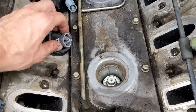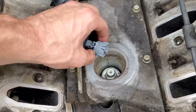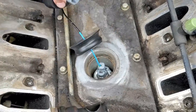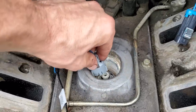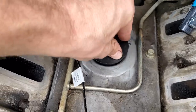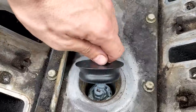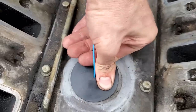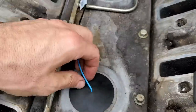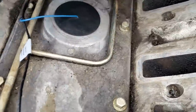All right, now that our new knock sensors are in and torqued to specification, go ahead and pop the connectors onto our knock sensors from our new harness. Just like so, and push our rubber plugs in there. Oh, these are tight. These are the new design. They're supposed to fit way snugger and be more watertight than the originals. Let's smack them boogers on there. There you go. Do they pop in place?